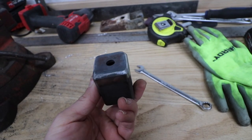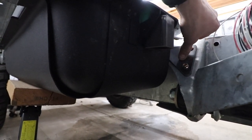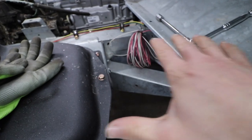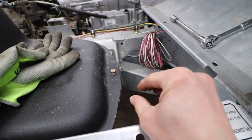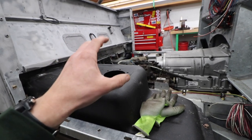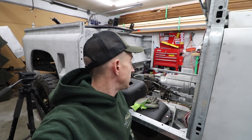Knocked out this little guy to start the bracket for the front of the fuel tank mount — that's just some square tube with a cap on top, bolt will go through there. So off this mount we're going to go straight across with a plate to that one and we're going to leave provisions to mount a skid plate for this guy so we can protect him from any rocks and whatnot. Once we get everything else mounted up here and we can see what we're dealing with sill-wise, we'll tie that into another point to keep it nice and sturdy. But for now just to there, so that way the tank is mounted. Then we can test fit the seat box to make sure our new fuel pump and everything clears — because that would be good if it did. I did the old calibrated eyeball measurements when I cut that and placed that, so we shall see, because that was done when there was only like an eighth of a Defender put together.